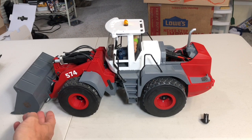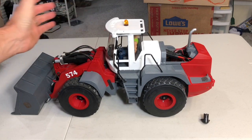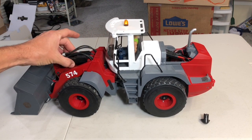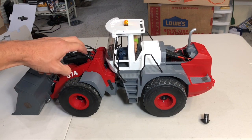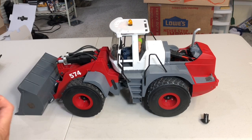Same way with your throttle throw — it's actually 92 down and around 115 up — but pay attention to the body. You don't want to put that force on the body; you'll end up damaging the unit. You could burn up the electronics or bust something on the machine itself. Most likely electronics will go first, or you'll bust something on the machine.